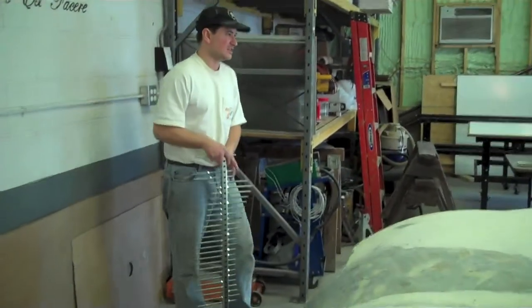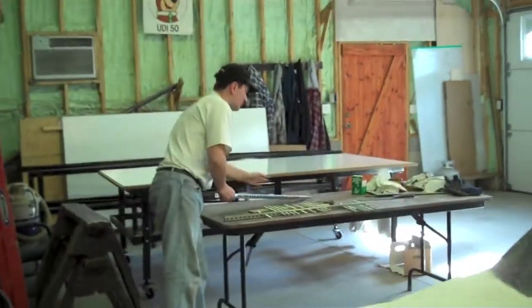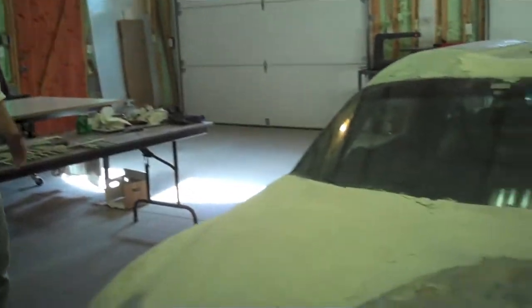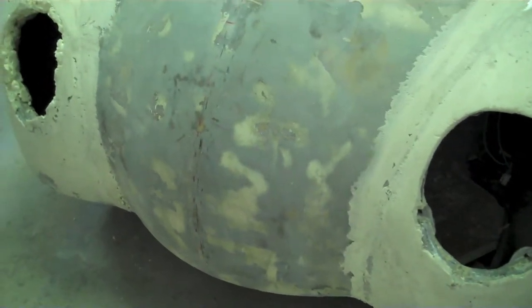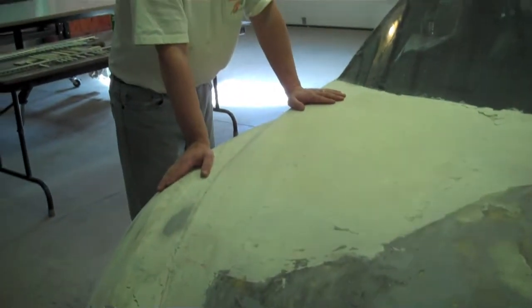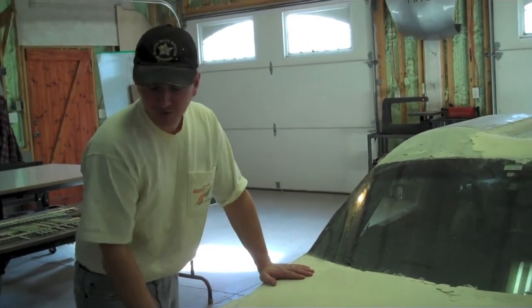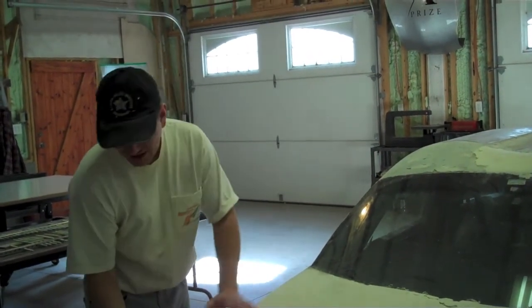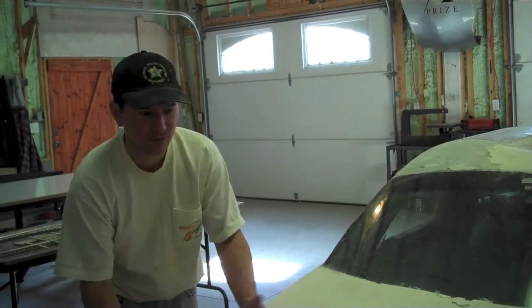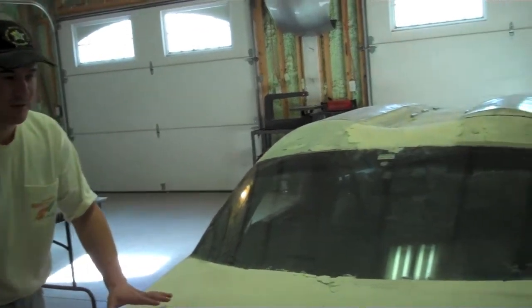We're still working on the headlights. In the end, what we're going for is to clean up the whole body of the car. Most of you have seen pictures and videos of it, but we didn't have a lot of time going into the competition or a lot of skill. We've had some people help us, we've developed skill and gotten more equipment, and we're going to make the car a lot smoother and more like we originally designed. The hood is going to open as a standard hood and lean back. We'll have separate fenders, all made out of carbon fiber and Kevlar. We're kind of using the car itself as the mold or the plug to make the molds off of.